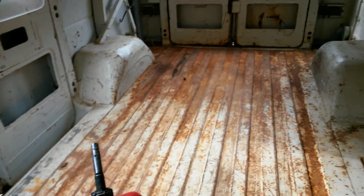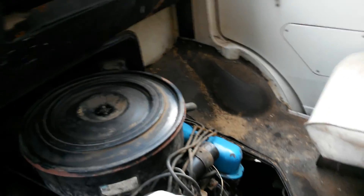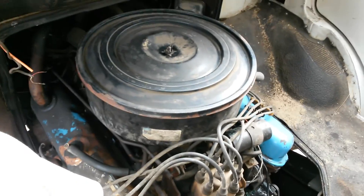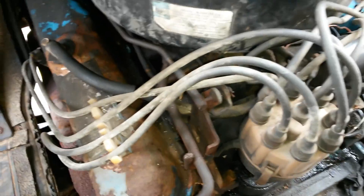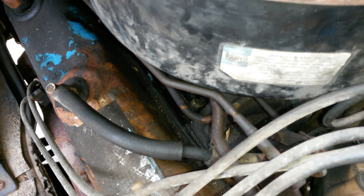You can see here's the back — very rusty, real crummy back there. Hopefully I can get all that stuff out. The first step was to get her running. She didn't want to crank, she spit up, and there was a flat spot in the carburetor. I think the accelerator pump was bad. It looks like there's been some creative tubing work down here — there's a little hose going in between two big hoses. I'm sure that's not good for it.